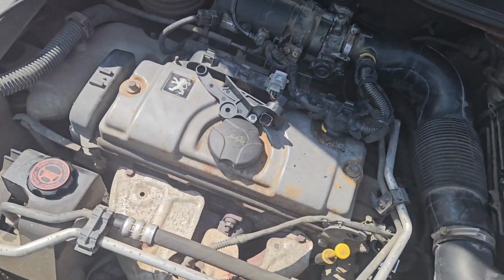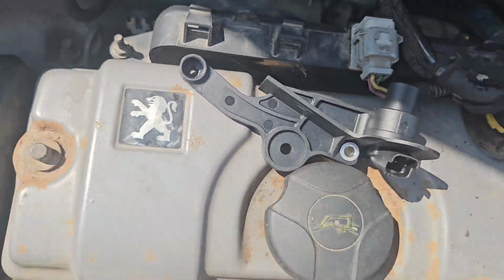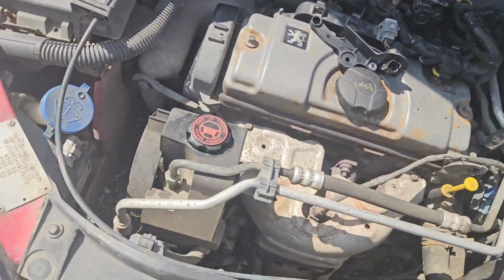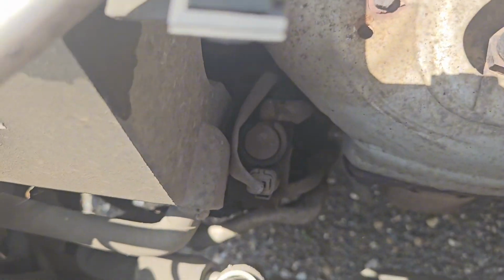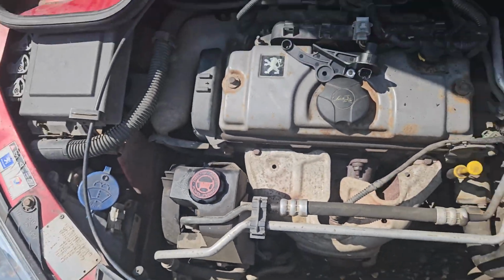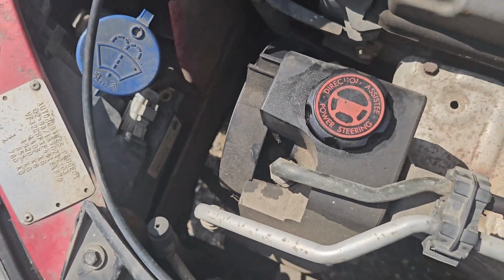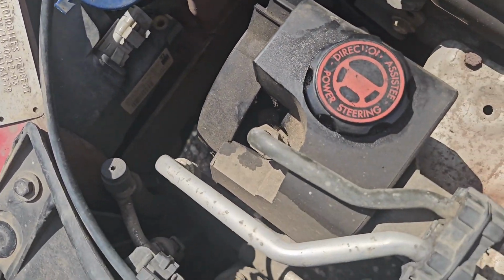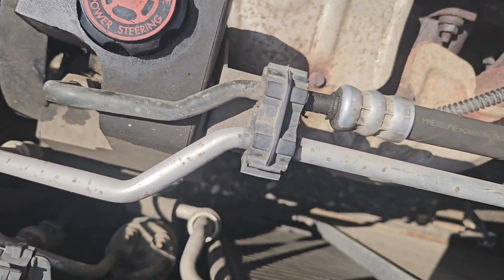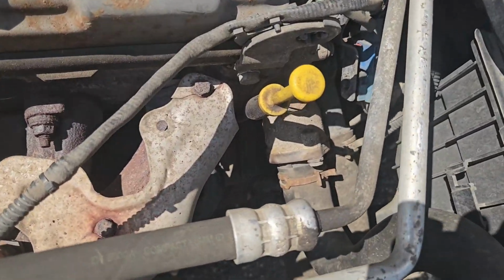Yeah, it's not the best introduction to my new car, must admit, but there's the crankshaft position sensor. That basically tells the car when to spark and when to put fuel in. So got to get a 10mm for this job. I reckon a wrench would probably do that. We'll try a socket first anyway, just to see what that does. This is going to be really awkward while we're doing it one-handed, so I'm probably just going to pause it.